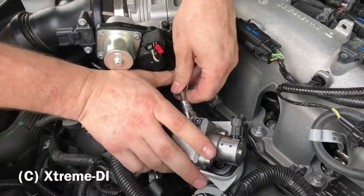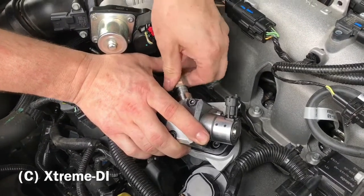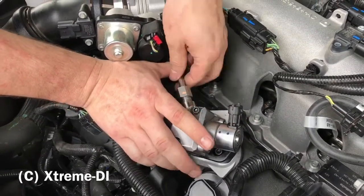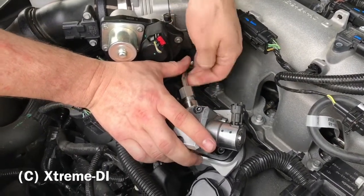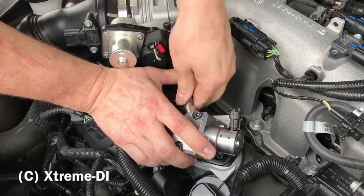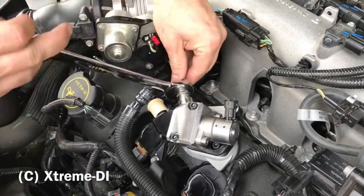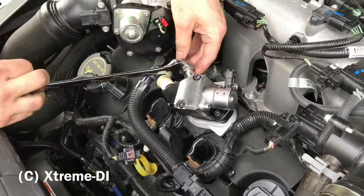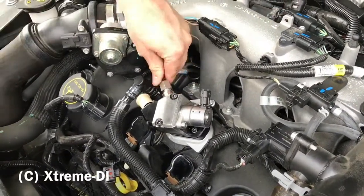And then what you have to do is to get the nut on, pretty much align it with the fitting. And then the nut should go on with your fingers. If you need force, it's somewhat cocked, so don't force it. It has to go on finger tight, and since it's coming on an angle a little bit, you pretty much have to tighten it with your fingers and then keep pushing the line a little bit until it's tight, and then you take your 17mm wrench again. And tighten up the rest.